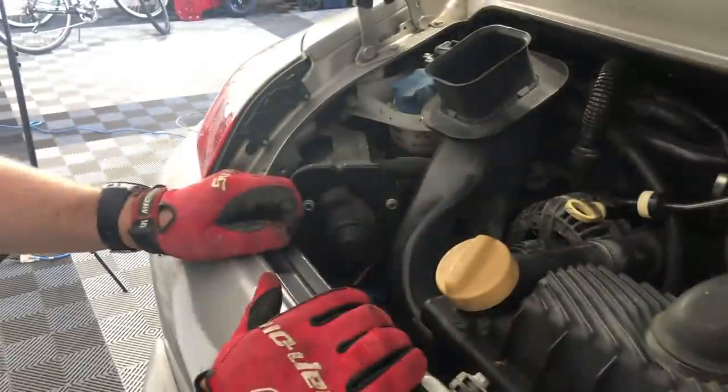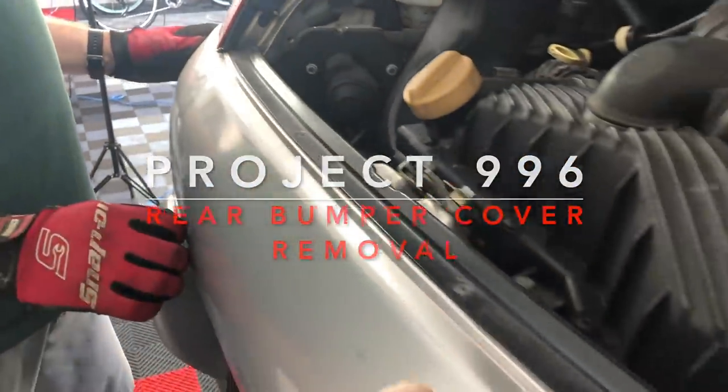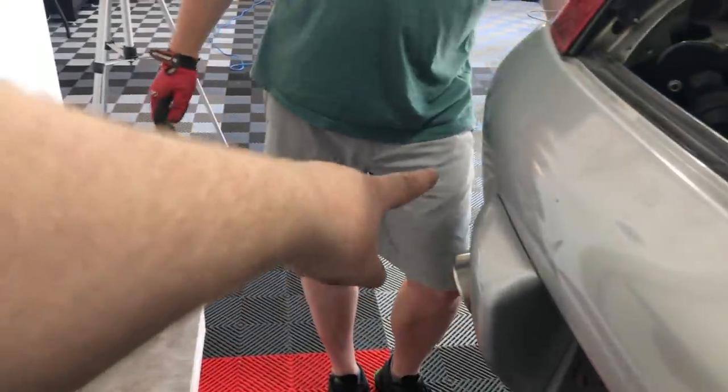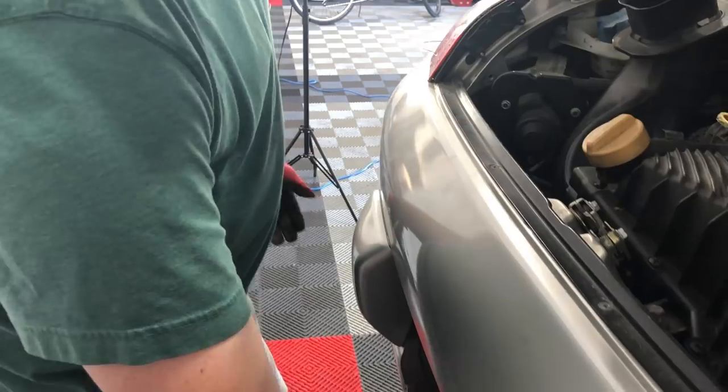First job of the afternoon: we're going to be taking off the rear bumper, and then we're going to take off the mufflers and send them over to California, where FD Motorsports are going to return some Pfister mufflers. Pat has brought his heavy-duty cutting gear in case we need to cut any of the bolts. To remove the rear bumper, we'll take out the taillights first on either side, then a couple of screws along the top, screws on the inside edge of the wheel well, and then screws running all the way along the back — probably four in the middle and two on either side. Then it should just come off.